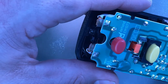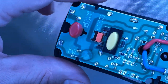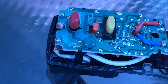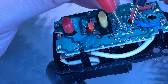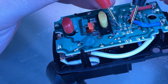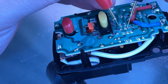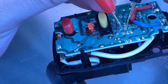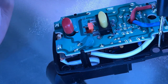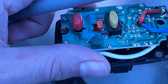But one of the things that I can see much better on this circuit board here is what's open, what's short. So for instance, I'm sorry I don't have a little thing to hold this still. These two are open, those two, so the middle pin is supposed to be tied to the 322. That makes sense. And this is not supposed to be shorted to either one of those. All right, and then this pin, there's no pad on this pin. Well, maybe it's just not used or anything like that.